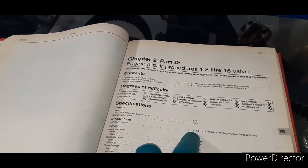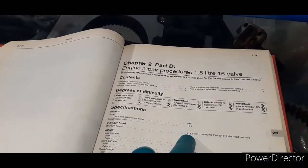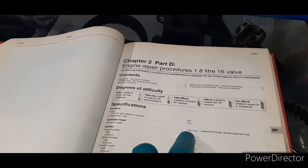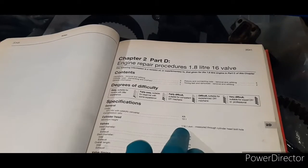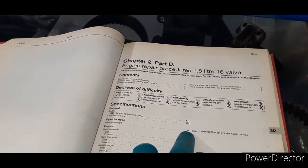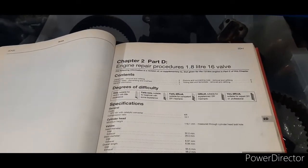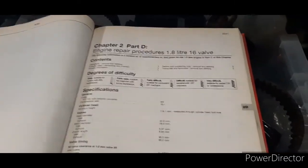What we want to do is make sure we know where it is relative to the deck height and the block, which I'll come to in another video, so we can maintain the same compression ratio with the head. We'll measure through various bolt holes to get a measurement as close as we can, and that'll give us a good idea whether it's been skimmed or not. This is a 16 valve and I'm rebuilding the 9A, but the cylinder head is an 027 head which is exactly the same casting as the KR's, so these measurements are the same vice versa.